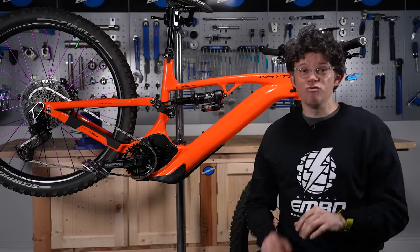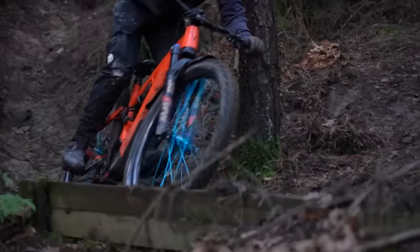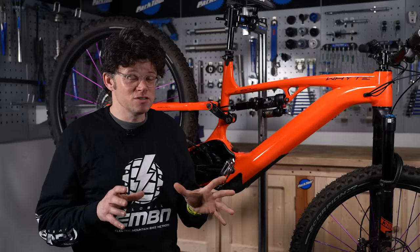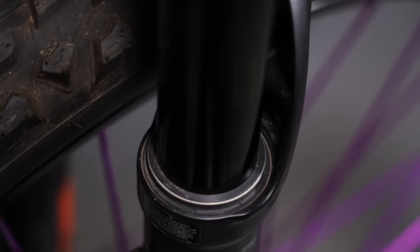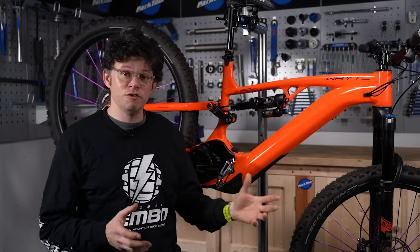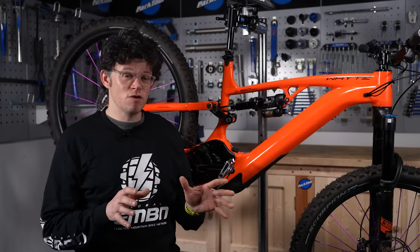You lot ride lots, and all that riding — boosted or not — adds up. E-bikes ride amazingly, and some of that amazingly planted feel comes from well-sorted suspension and dialed kinematics, and the wonderful balance between sprung and unsprung mass. But if you're going to ride lots, you've got to keep on top of servicing your suspension. You might be surprised at how short the service interval is: a lower leg and air can service on Fox is after only 30 hours of riding; RockShox is a little longer at 50 hours. Keep on top of that regular maintenance and it won't get too expensive.